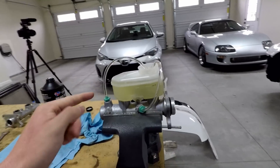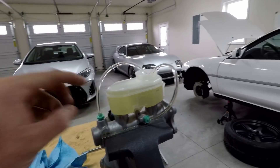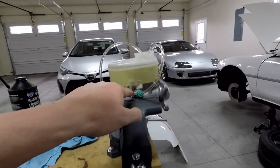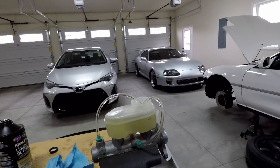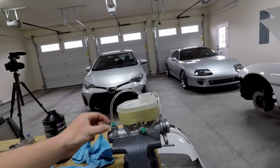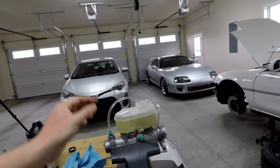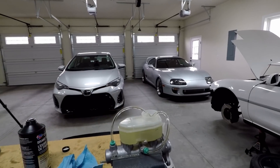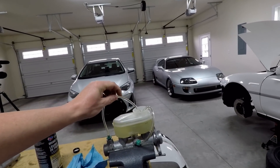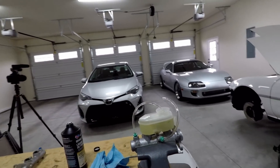It's probably going to be hard for you guys to see, but what you're doing is literally airing out the system. There are still a couple of little bubbles in here — we want to get those flushed out as much as possible. You're recirculating the fluid back through, taking out all the air that's in the cylinder. Once you've done this you can remove the fittings — it'll just be a few little drops — then you're good to go. You can bolt it up and that's it. Pretty simple.